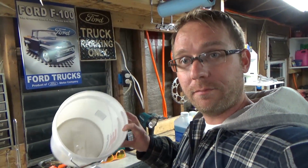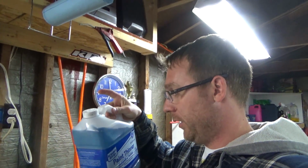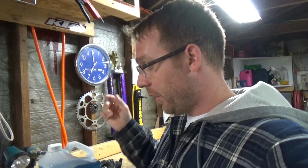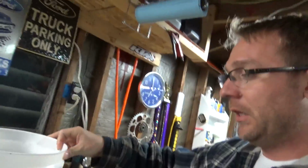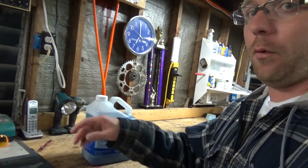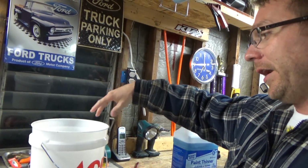All right, so last piece, which makes this oil filter changing, cleaning, cost effective, is when you're done, you pretty much are gonna dump out everything that's in here right back in your bottle. Again, mine's blue color now because that's what color the filter dye is from Bel-Ray. I just dump it all in there. Some of the sediments are down in the bottom. But usually everything kind of settles in the bottom of the mineral spirits. And maybe before I pour it back into my bucket, I'll put a t-shirt over it and then pour it in, and that gets most of the contaminants, but it's not too big of a deal.